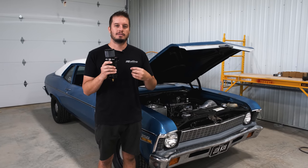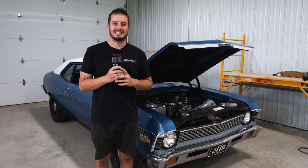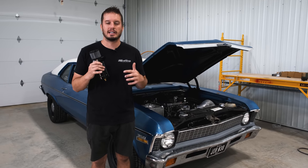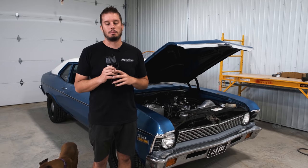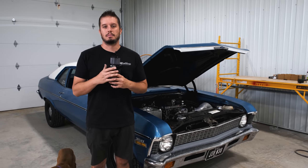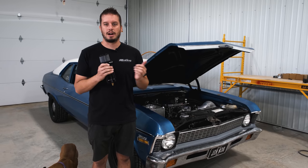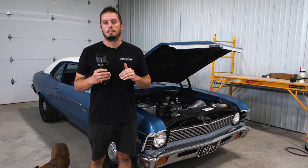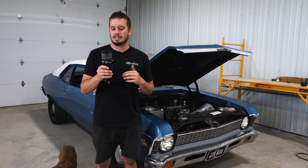Putting the air back into the intake of the engine risks putting oil back in. There's always going to be some remnant particulate — if you put oil into the intake it is a recipe for disaster. It causes detonation, it causes oily crusty intakes and intake valves — all the stuff you see when you tear apart a stock engine. It all becomes a messy disaster that causes parts failure. On a performance application, oil coming into the charge is never a good idea. So what we do is plug the intake up. This will require tuning on a vehicle if you previously had it traditionally plumbed into the intake, because you are changing the amount of air going in. But it's usually pretty minimal and not a big deal typically. So going back to baffling — make sure your baffling is up to par.